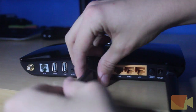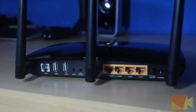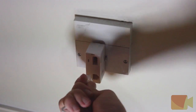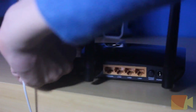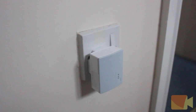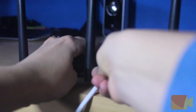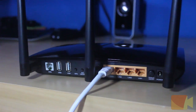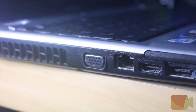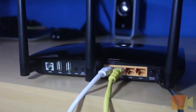It's very easy to set up this router. First you're going to want to screw on all three external antennas, then you need to connect the ADSL cable from the phone line in the wall to the router if you are using this as your main router, or alternatively an ethernet cable from your existing router either directly or via home plugs into the LAN 4/WAN port if you are using this as a wireless access point. After that, connect an ethernet cable from the router to your computer, then finally connect up the power source before powering on the router.